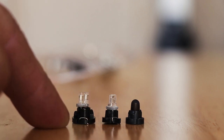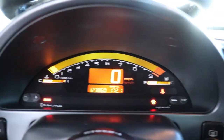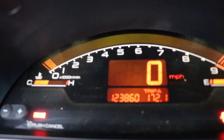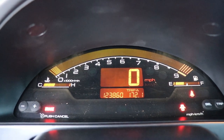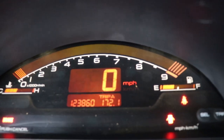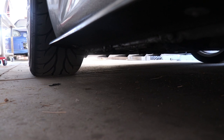As you can see, this is my normal lighting situation without the headlights turned on. Let's turn the headlights on and see if you can see the flicker here in the daylight. You can kind of see it right above or in the RPM gauge - that's what we're aiming to fix. I don't know if you guys can hear that whirring sound but that's also the noise we're hearing - it only happens when the headlights are on with a high electrical load. Turn the lights off and it always goes away. Hopefully that alternator piece fixes it.